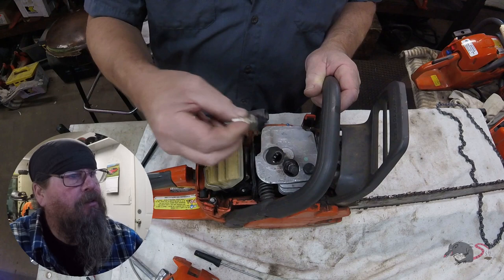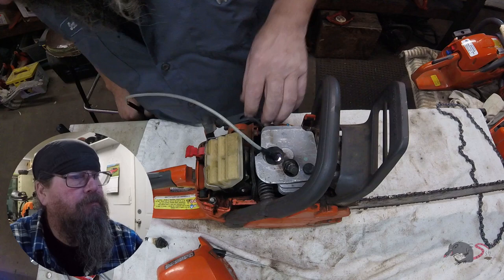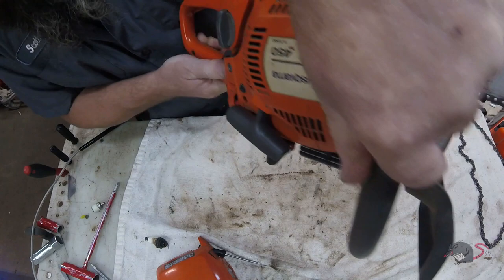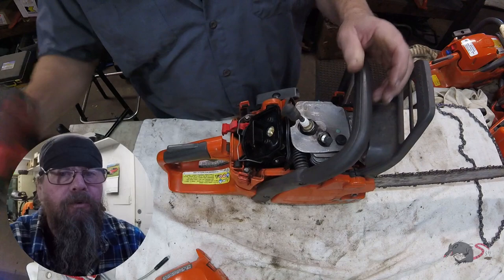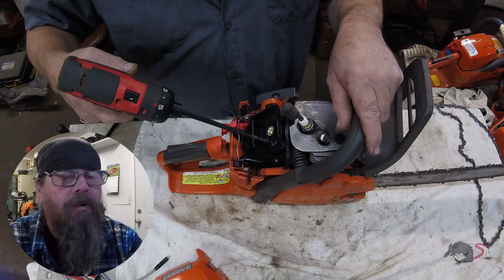So I'm going to take a look inside — that spark plug is really wet. We're going to take a look inside the cylinder and see if we can see that it's flooded or not. Yeah, that was a lot of fuel. I think if I would have kept pulling on that rope it would have just kept pumping fuel out. But we'll dig deeper into this carburetor and try to pinpoint the problem.